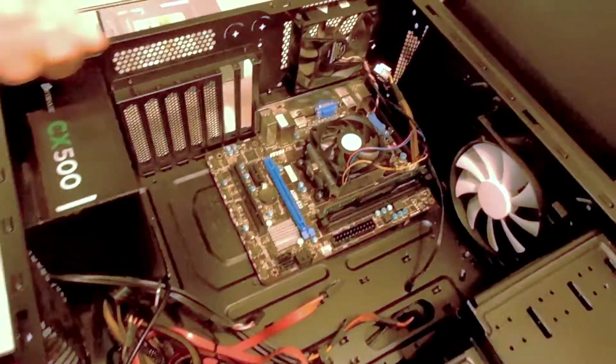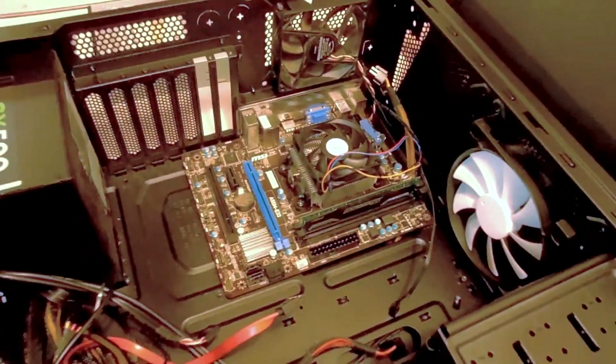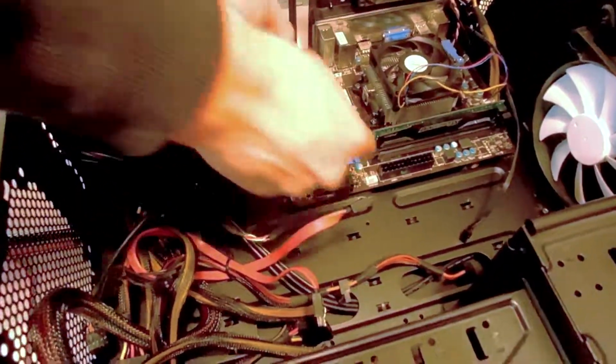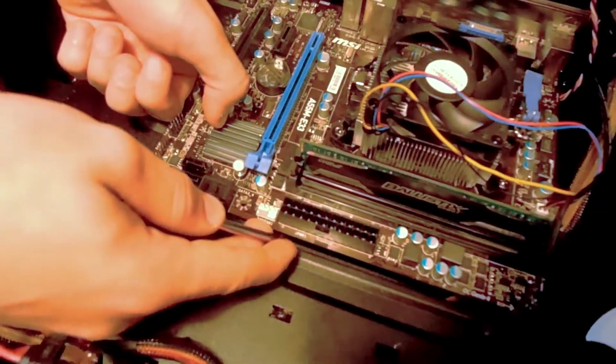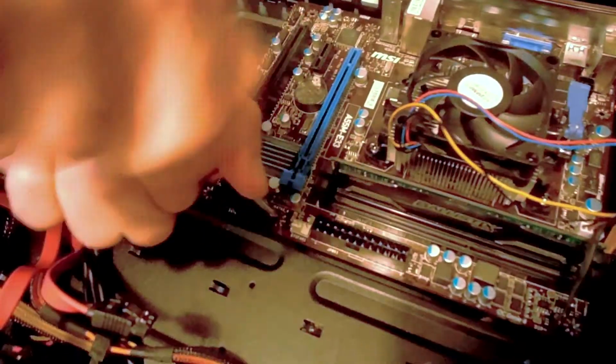And you got to make sure the screw is not too tight, because you don't want to crack your motherboard in half. Okay, whoever out there is trying to pretend to be Hulk in your living room, don't take it out on your computer. So you're basically just going to screw it in like any other screw, not too complicated.